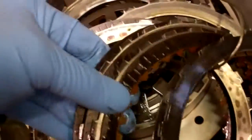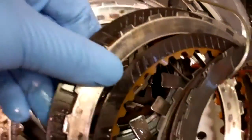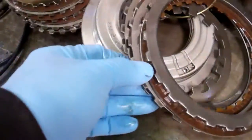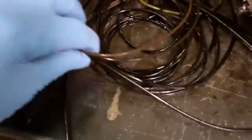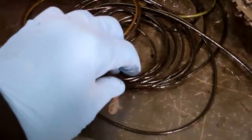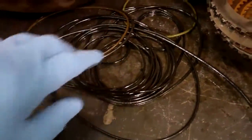If you can see these, it's got hot spots right here that should be smooth silver. The clutches are burnt black, and these clutches are just basically no good. They're just burned up. The ones that aren't burned up are worn real thin, and they're no good. And these are all the rubber seals that go on all those pistons, and they're worn out.